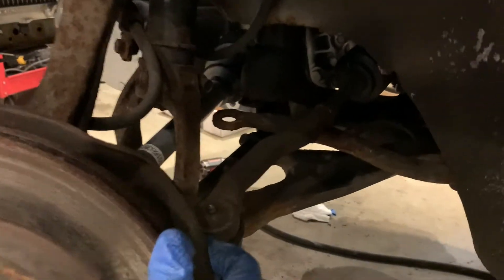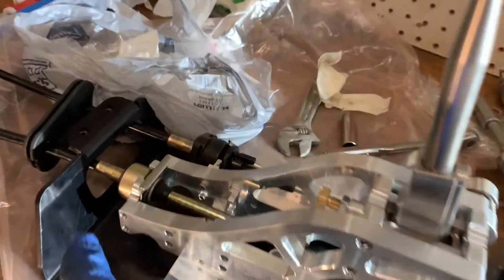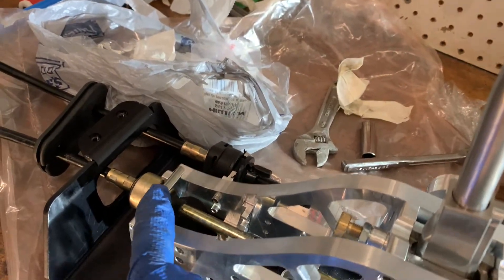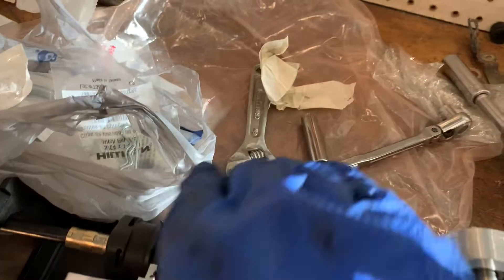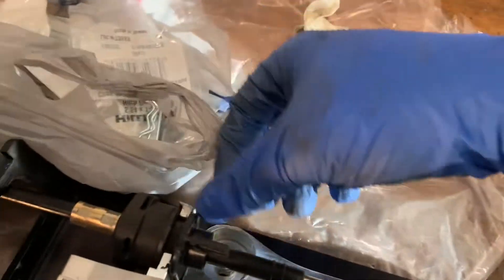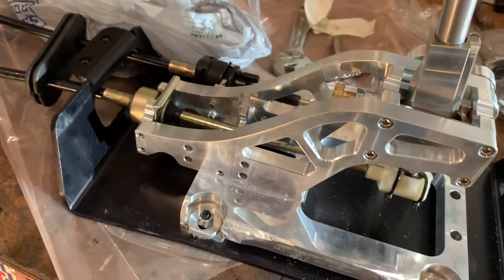I got a little carried away because I had my brother out here helping me, but we got both the axles in. Suspension isn't fully bolted down yet and we took the shifter out and got the cables hooked up. This is an OEM Honda clip I bought straight from Honda - that slipped right in. The other one just goes in without a clip and you rotate it to snap it in. These are the Accord shifter cables, so that's how those work.